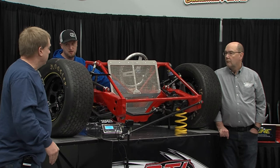When you change the ride height a lot, aren't you changing the roll center? You are, but you're getting to your migration — where your roll center is going to be ultimately. Those diagrams we used yesterday showed things set in static mode; now we're talking about dynamic mode. It's kind of like a shock — you're manipulating the car to get it to where if you could just set the car to the dynamics of what you want to race at, that's really where most teams would set their ride heights. But you'd never get through tech. Static ride heights, I think in the future, are going to be a thing of the past — it's going to be load-stick the car and go racing.